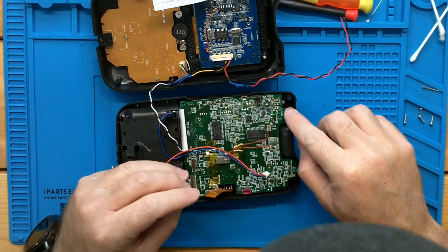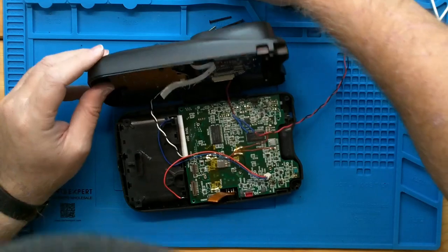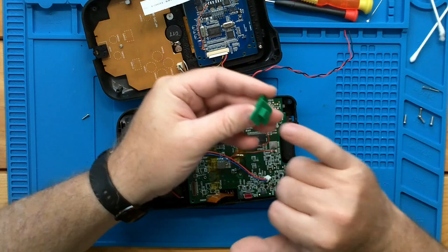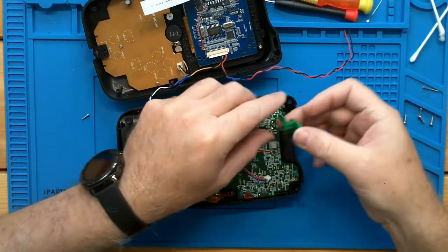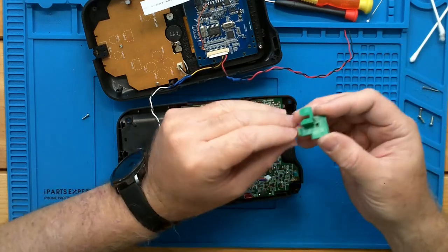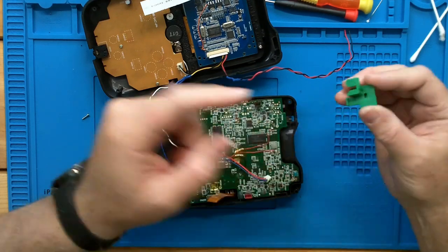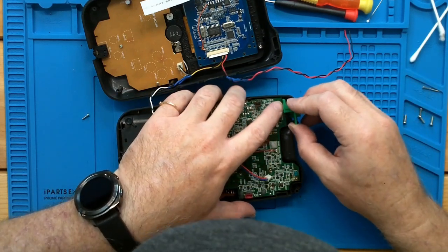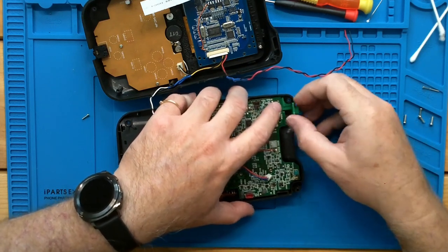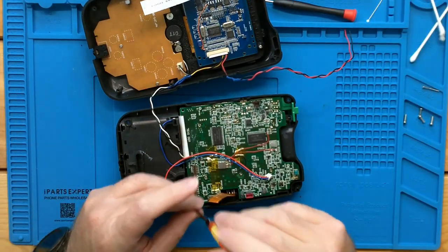So, you know what? Let's make sure our switch is in before we put the screws in the case, just in case we need to lift it. Just like with an original Game Boy, this is kind of captured underneath. Also, there's a tab that needs to come in underneath that will be exposed, and this keeps the cartridge from being pulled out when the game's running. So I don't know if this one, okay, this one will sneak right past the board and it'll drop in and we're good. And now we can put the one screw up here in the corner.